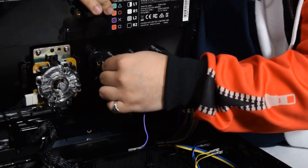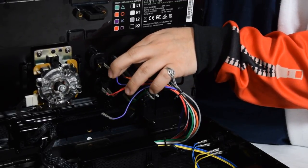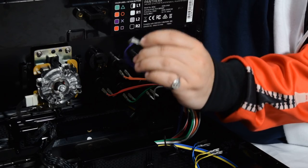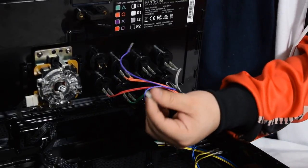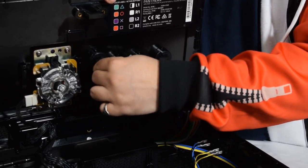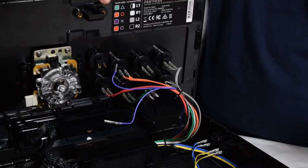That one, these actually are a little bit difficult. I have not had the chance to pull these out, because everybody has switched to these, the quick disconnect versions. You generally just push down a tab and they come out pretty easily. Don't pull them out like I did. Make sure they have that little tab in there. If they do, you have to push that and pull it, because I've seen people rip the bottoms of these buttons out trying to pull the quick disconnects out. And if you pull them out like I did, they generally go back in kind of loose. As you can see, it's really loose now, because it messes up the part that latches onto the button. It doesn't affect function, it's just not as secure anymore.